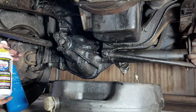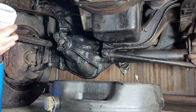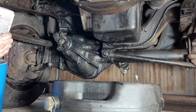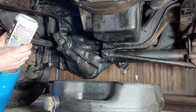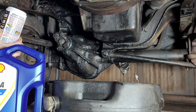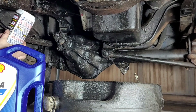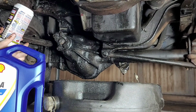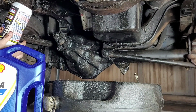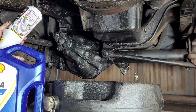And this is your Lucas Pure Synthetic Oil Stabilizer. You don't have to do this. It just adds up nicely, because I run Rotella T6 5W-40. This is not a plug for them, but they do make some nice products. And on the 7.3s, in the wintertime especially, getting your oil to be able to pump up is crucial to getting your truck to start in the cold. You've got good glow plugs, good batteries, and a good oil, and you shouldn't have any problems at all with your truck starting, even when it's in the single digits.